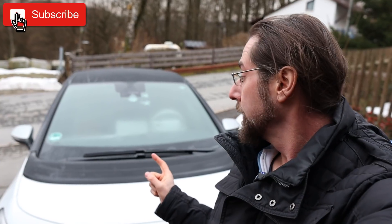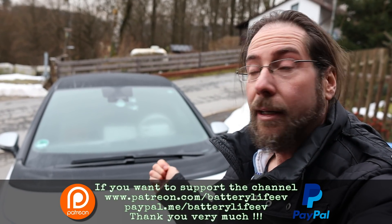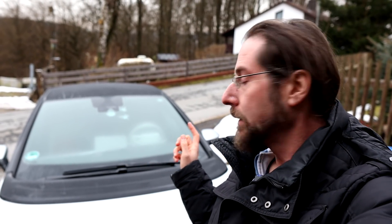Good morning everyone, thanks for hanging out with me. Today I want to talk about the ID.3 and fast charging. The ID.3 can charge DC with 100 kilowatt, but like every other EV, when the battery is cold because of cold outside temperature and you let it park, that means lower charging speed. So what I'm trying to do today is show you what the car does with the battery heater, and what you can do while driving to get the temperature up so you get your 100 kilowatt.